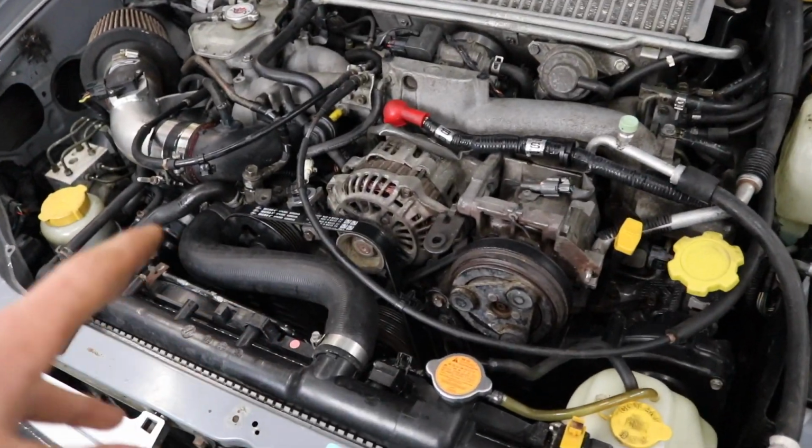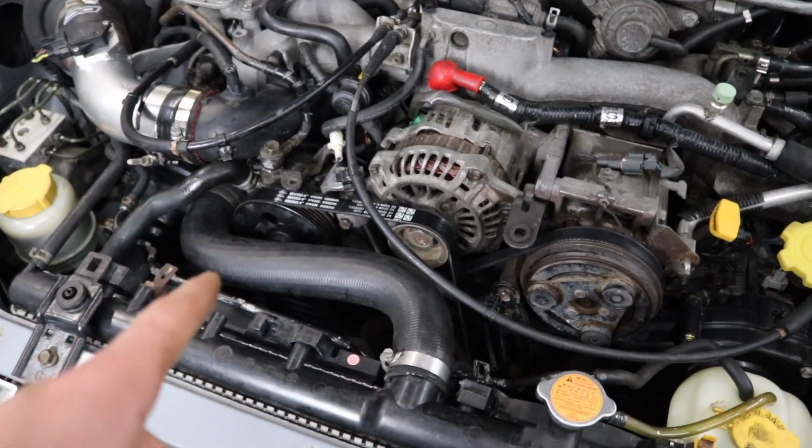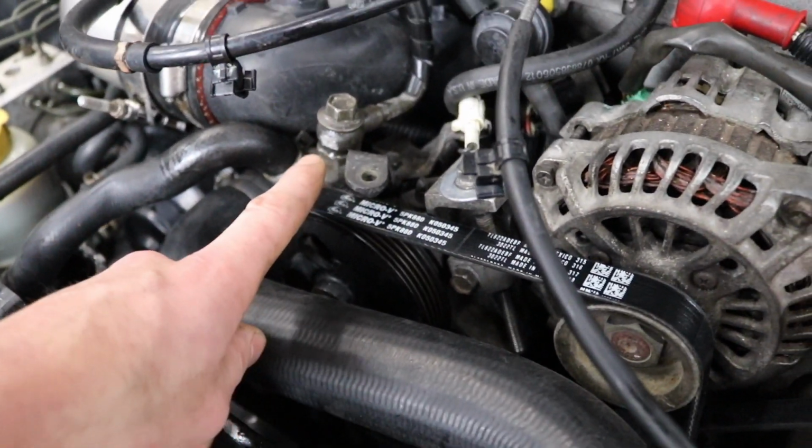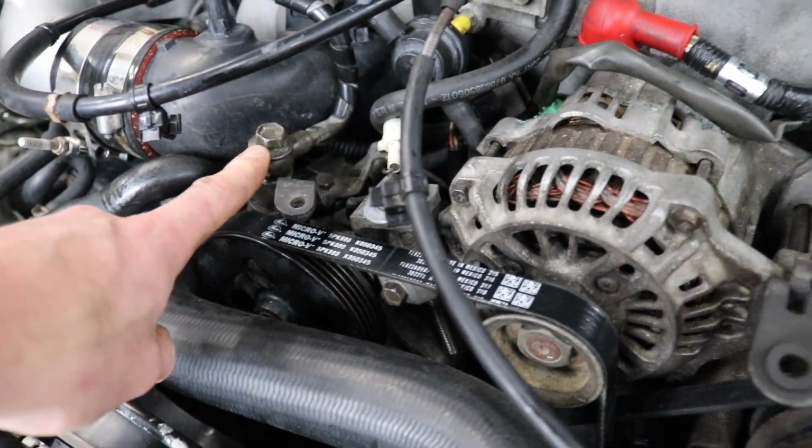We got the pump all swapped out now. Everything is completely buttoned up. One thing that is gonna be a little sus, I didn't replace the two crush washers on the high pressure fitting for the power steering pump. I just tightened the shit out of the top bolt. So hopefully that doesn't leak.